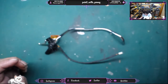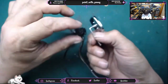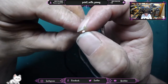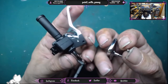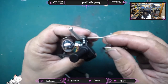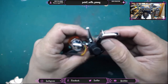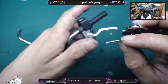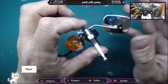I did forget one thing — the left indicator. The actual stick, just like the handlebar grip and the handlebars, has got a little flat bit, and on there you have a flat bit too. What we do is line those up — there's the flat bit, there's the flat bit — and in it goes. Be careful not to force it, because if you need to force it, it could be that you haven't quite got it in position properly. And in it goes, just like that.